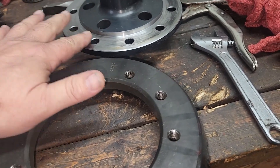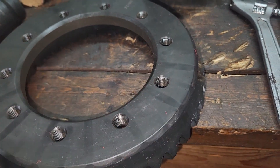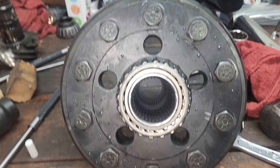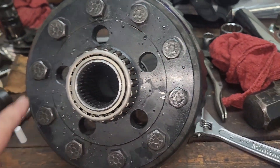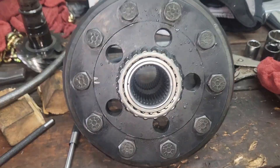Alright, now we're going to go ahead and put the ring gear on. Make sure your surfaces are nice and flat - if not you can hit it with a flat file. I don't feel anything so let's go ahead and slap them together and try to line up the holes as we do so. The kit came with some red loctite, so we'll put that on our new bolts. I tightened up one and then the opposite one, back and forth, until it pulled them together, then hand tightened the rest. Now we're going to torque it in two waves in a criss-cross pattern. This video is getting a little long so we'll go ahead and make this part one, and then part two will be actually putting the gears in the rear end.